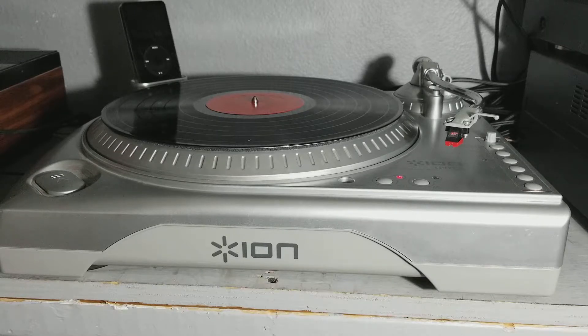So not only did the music speed up and slow down, but you would also hear this weird rumbling from the platter deformation, and that happened quite a lot. As a matter of fact, I've bought several of these because I personally love them, and every single one I've bought — every single one my friends have had — they all have the same problem with the platter. The second problem is the tracking on the stylus. It is very difficult to set the tracking on these, so I'm going to go over that today.